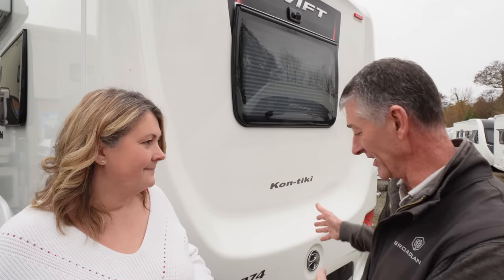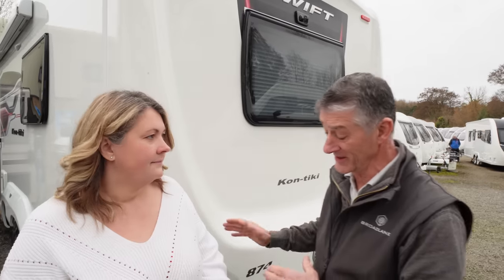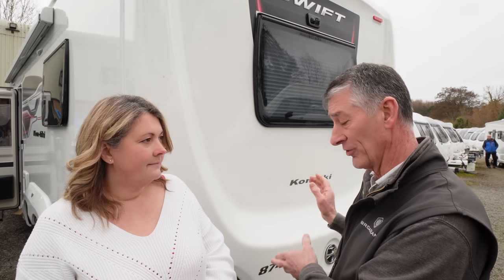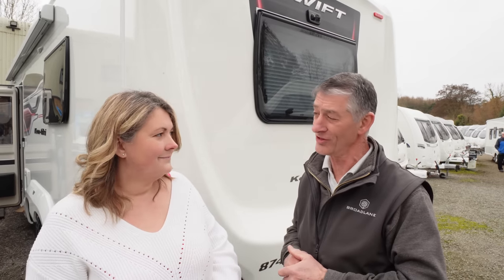The AWS hab check usually covers eight different parts to the van. The first one we're going to look at is the underbody. The underbody covers the external part of the chassis — you may have additional legs fitted to the rear of the vehicle and we just need to make sure they operate correctly and are lubricated. It also includes the mechanical operation of a step if fitted, and the onboard tanks — fresh and wastewater — to make sure they're secure and the pipes are still attached.